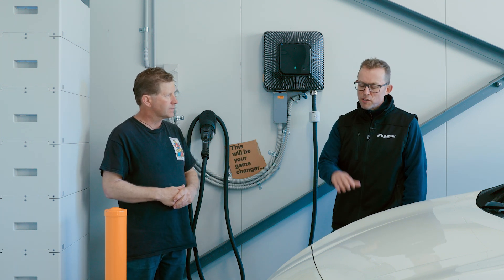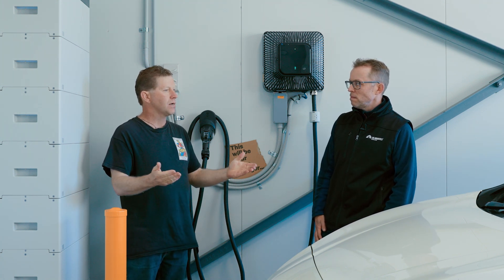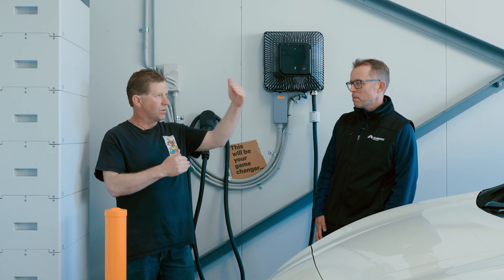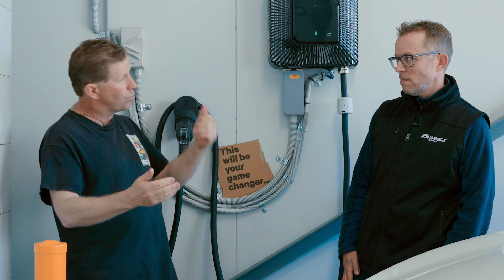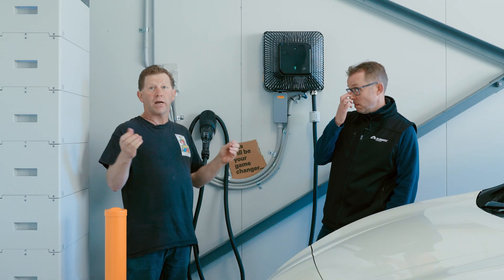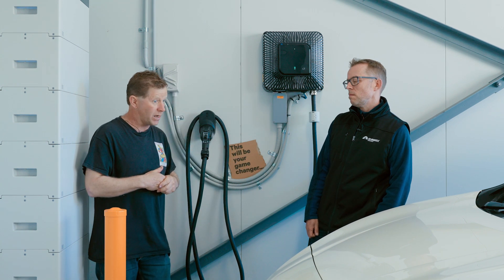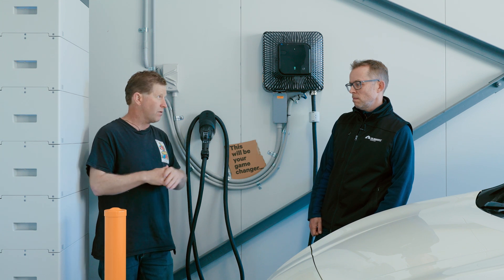On average at this time of year they're draining about 20 kilowatt-hours overnight, staying within the 80% to 20% charge range. They're only setting it between 2 and 3 kilowatts because that's all they're using. At that rate you're not really degrading the battery much because you're not fast charging and discharging at 50 kilowatts via the CHAdeMO plug, which really does degrade the battery over time.